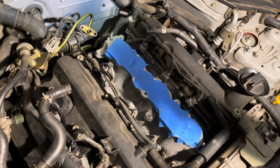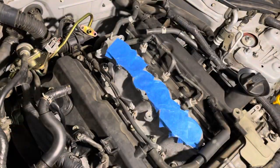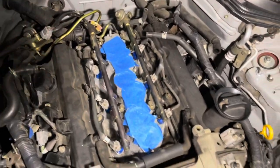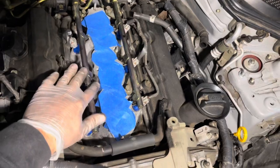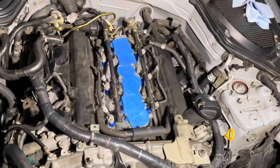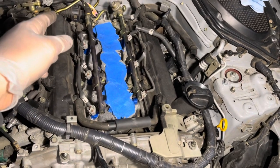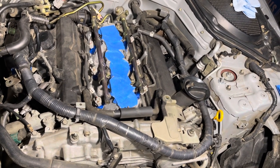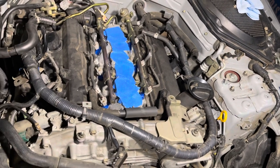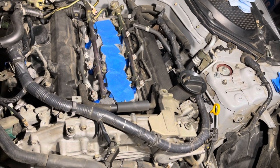That was five foot-pounds of torque. Right now we're gonna set it to 19. We have it torqued down. Right now I'm gonna go ahead and put the fuel rails with the new injectors in. I've torqued down the lower plenum and put in the fuel rails with the injectors, held in by four bolts — I'm gonna torque them down to 19 foot-pounds as well. I'm gonna hook up the fuel feed and prime the system to check for leaks. We want to catch any leaks before we put the other intakes on, because if there is a leak there's a high chance of fire, which nobody wants.